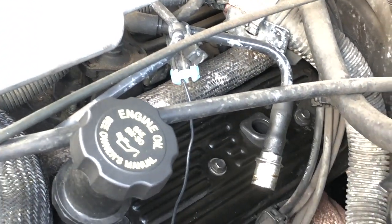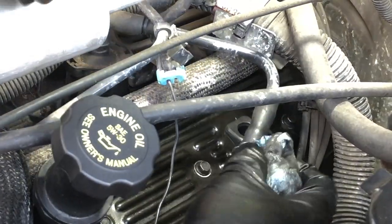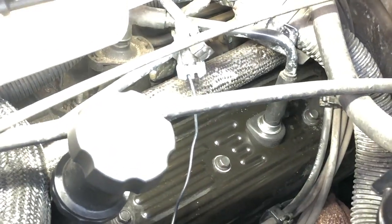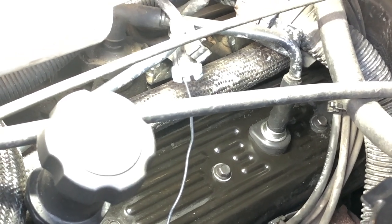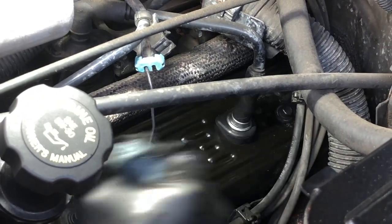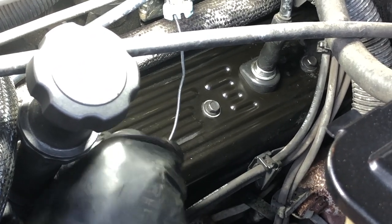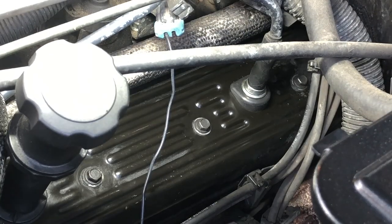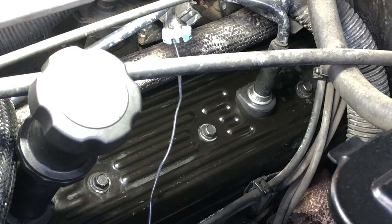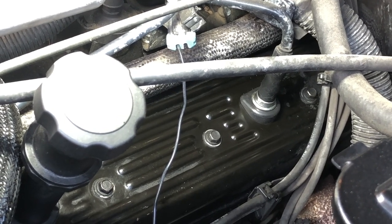I wanted to give the PCV a quick wipe off before pushing it back in. And so we're all set — a pretty simple, straightforward repair. That should take care of the leaks on both sides at these grommets. Then we'll just continue cleaning up this valve cover and watch to see if we get anything out of these bolts that hold it down — sometimes they can get loose and you might need to re-torque them. In this case these aren't leaking, but cleaning it up like this is an easy way to tell. I hope this helped you out. If you have questions or comments, or even different part numbers for a different engine than what I'm showing, go ahead and leave that below. Otherwise, please like and subscribe — thanks for watching.